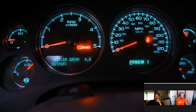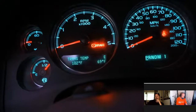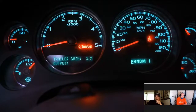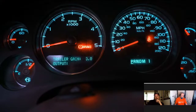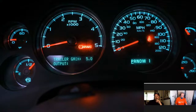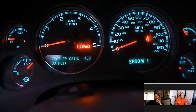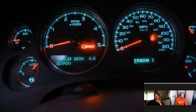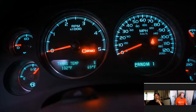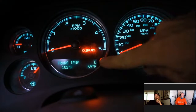As I let off the brake the voltage goes away. Every vehicle is different, so I can't tell you exactly what numbers are best for you. I've run anywhere from a gain setting of 3 up to 5 depending on terrain. The default in our truck was set to 4.0. One other display I always keep on is transmission temperature.